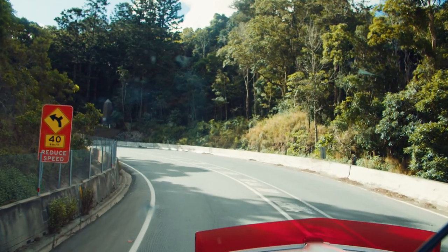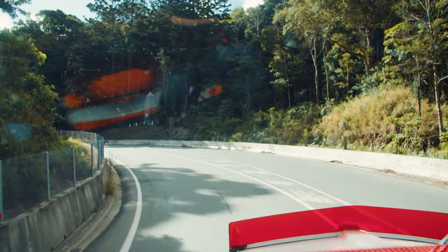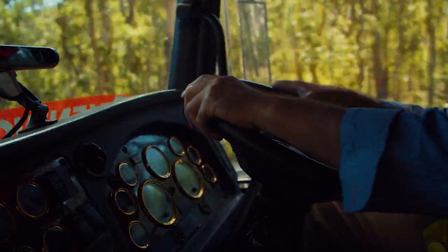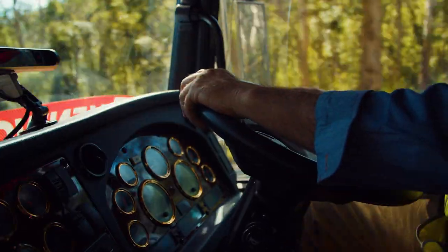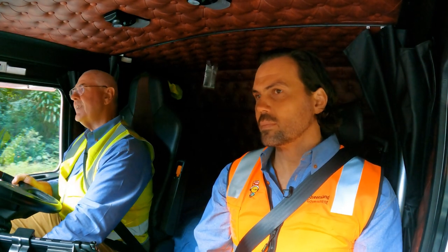So we've just reached the top of Cunningham's Gap - there's a pinch point at the top. I can hear the truck's thermo fan has now come on, so we've obviously built up a fair bit of heat coming up the hill. I'm just going to take off the power divider now - turn the power divider off, lift off the accelerator, power divider's off, and reapply the accelerator. Now we're good to go.